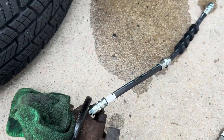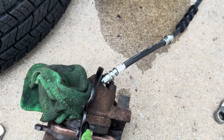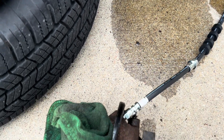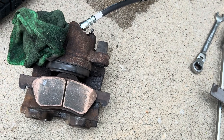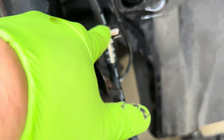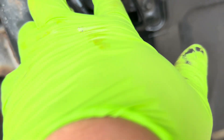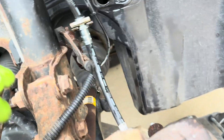New hose — if you compress it, it's just easy, no effort at all, and brake fluid will just gush out. I put the clips back — same thing with this one. There are slots that will align with the bracket, so just align those slots, insert the clip, and it will get secured properly.